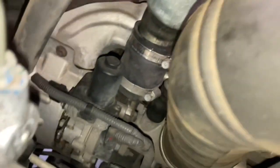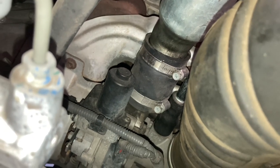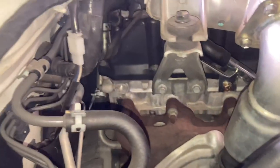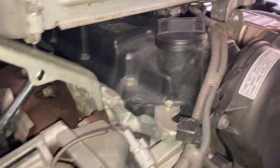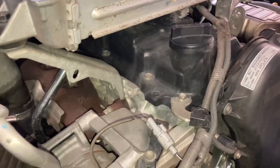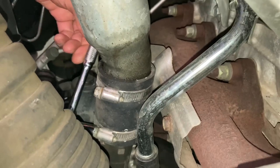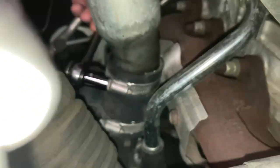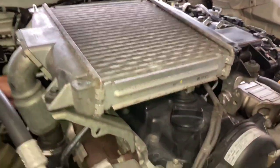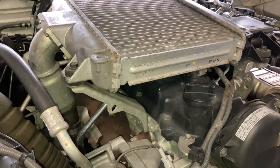The information is there for people that want to be educated. So let's get the quarter drive and check that other one — it could be too loose as well. Let's nip it a little bit, and the other one on the turbo side while we're at it. This one here — I'm seeing the right amount of deflection in the rubber, I think this one's all right. Get your hand in there — yeah, a few clicks on that one as well, because there is a little bit of oil there too. So we're having a recall — anyone that's had their injectors done, we're going to have a recall day.